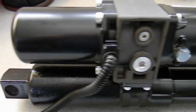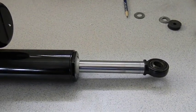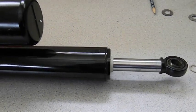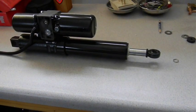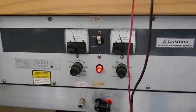This is retracting. It takes about 7 amps to run this motor pump. Here's the hydraulic ram retracting — that ram can rotate. She's almost completely retracted now. Power supply is 7 amps, 12 volts.